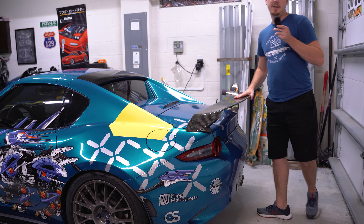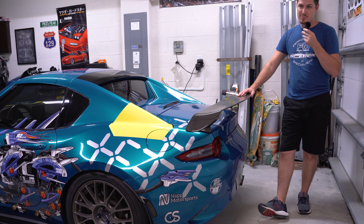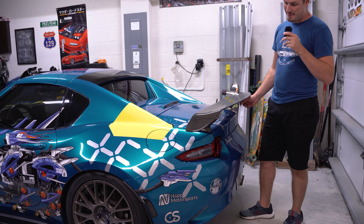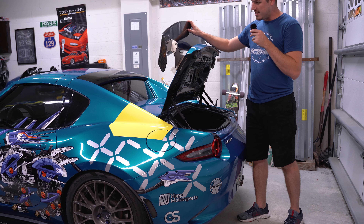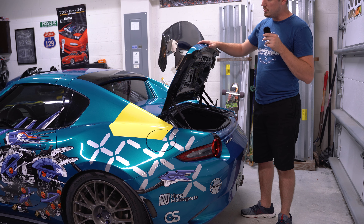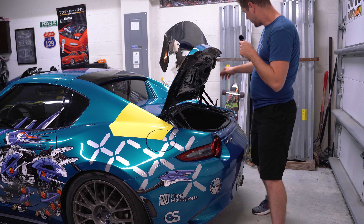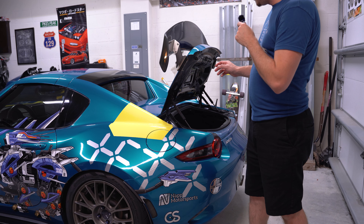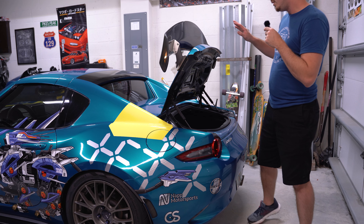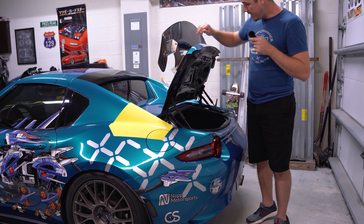Starting with the back — the most proud project I've worked on with this car would have to be the wing. It was one of the first real metal fabrication jobs I've ever worked on on a car. This was a SARD FRS wing for a BRZ that I was able to make extended brackets for to fit on the ND Miata. It simply clamps onto the underside of the trunk lid so you don't have to drill any holes, and I was able to make it clear the RF top with some lowered stands as well. Really cool mod — I still sell the brackets.